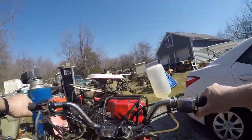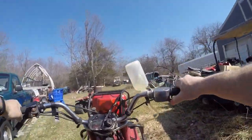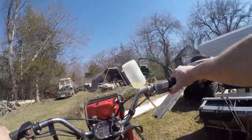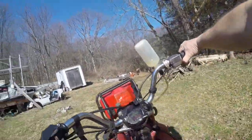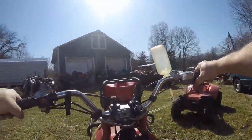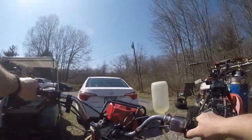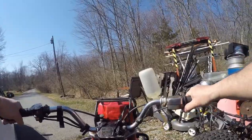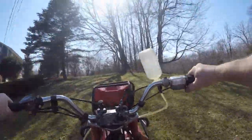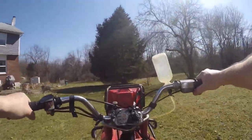Normally you don't have to adjust these carburetors, but I'm a little surprised — this one didn't behave all that well until I tweaked the idle mixture. Normally I just open the idle mixture up one full turn and it's all good. This one was a little fussier — I had to give it a little more than a half turn beyond that. But yeah, I'm happy with it.